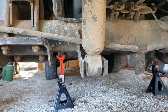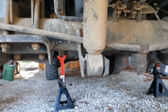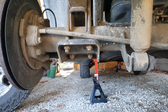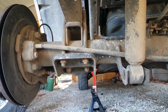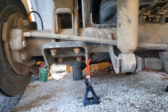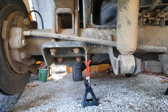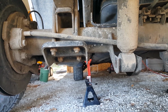So kind of a recap, as I do the driver's side, take off the shock bottom bolt here, and go ahead and then take off the, I use air power on here, air ratchet for the bottom of the bolts here, and take it off, put the new U-bolts on, and so when you lower the rear diff, it will slide right down into place.